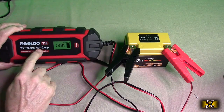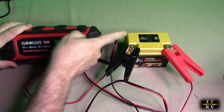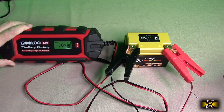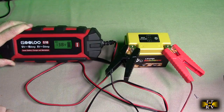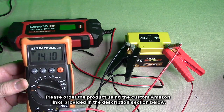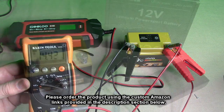I'll demonstrate — I'm using this charger which will work with lead acid. You also have different choices on here, but I want to show you that you can go to the standard 12-volt lead acid battery setting and it'll work. It'll charge this up because the charging profile matches lead acid, so it'll work in your ATV or motorcycle with the circuitry that sends energy to your lead acid battery. You can see it's almost up to 14 volts already — it took about two or three minutes to get back to the level it was before I put that load on there, and now I want to fully charge the battery up to its full capacity.